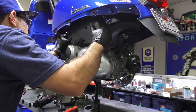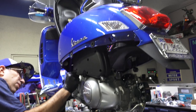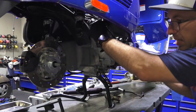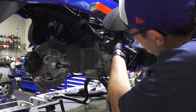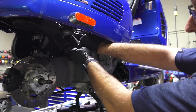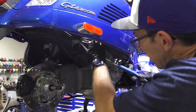And sometimes just getting all this stuff to line up. Yeah, there we go. Don't get too crazy and just torque the first nut. Get everything in. This is your wheel speed sensor. I left that nut or bolt loose on this fender here. So pull the bolt out. In 2015 and later, we'll have this sensor like this for the ABS system and wheel speed.